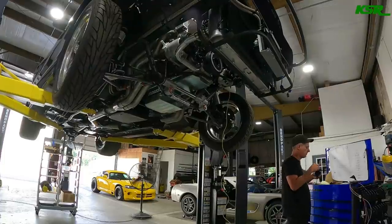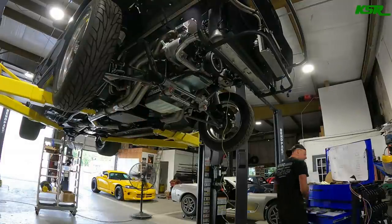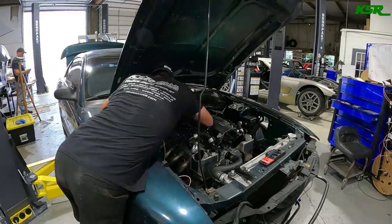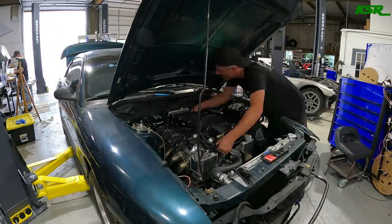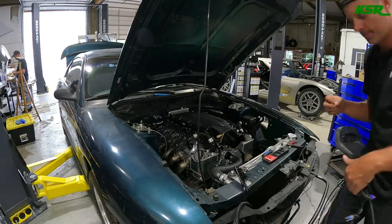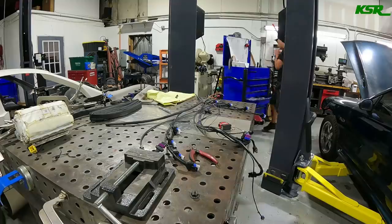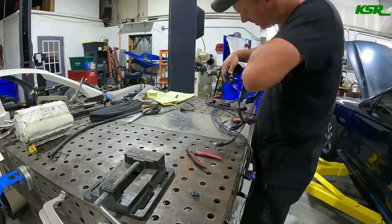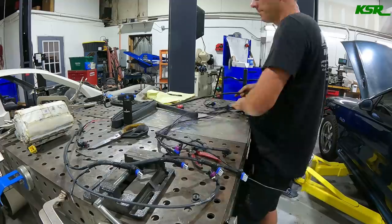I ran the car up in the air to plug on the crankshaft sensor. On this car — and really all LS engines — you need to take the starter loose to access it. There was also a header in the way, so I had to loosen the header just a little bit to get wiggle room and reach the starter bolts to get my arms in there and snap the connector on. All of that just to get the right length for where the crankshaft sensor connects to the rest of the bundle.